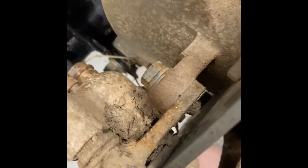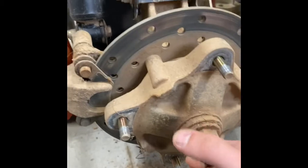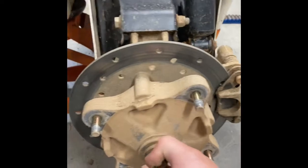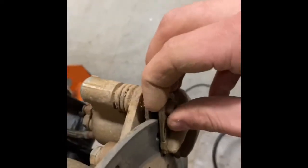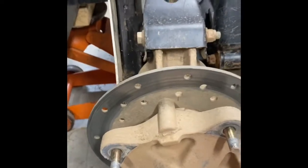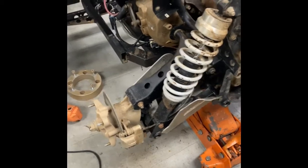Rear tires are off. The back calipers might be salvageable — they didn't wear them plumb down to where the actual pads are missing. As for the bearings, can't really tell because there's so much control arm play with the bushings being worn out. The other side's actually worse. They gave an axle for this side because it's busted, so that should be a job. The caliper may be able to be saved. I'm going to take one side completely apart — probably the driver's side — get everything off, see where I stand, then move over to the passenger side.